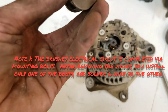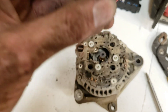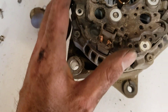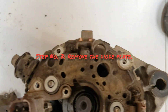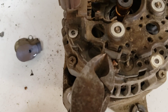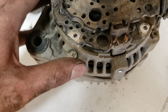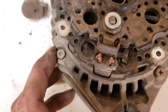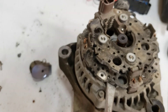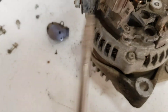There's brushes in there. There's a little spot right there — you can use a paper clip or something after you push these back to get it back on. Then you remove all the screws. Then you take dikes and clip the little top spot welds off each of the six wires that are on here. Then just come in with a screwdriver and kind of pry her up and get her loose. Straight off.